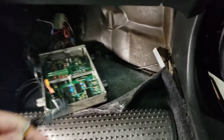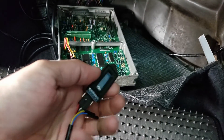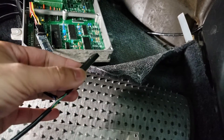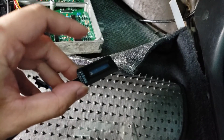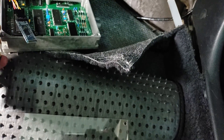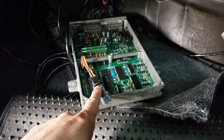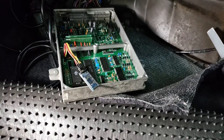Now to hook it up into the car — I decided to hook up the one I just programmed. I've also 3D printed a holder for it so we can glue it on the side of the ECU housing, or just use double-sided tape. That way it doesn't short, because as you can see these parts are exposed, so I'll have it leveled up so it doesn't actually short anything when it hits the ECU case. So we're going to disconnect this from the programming cable and then plug it into the ECU. I'll go over the wiring once I plug it in.